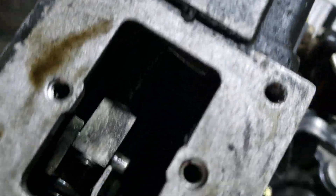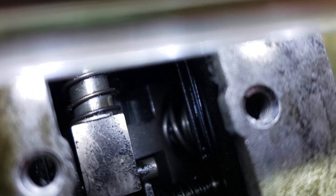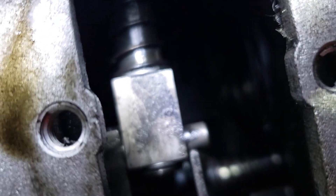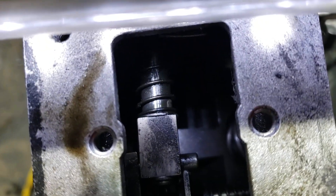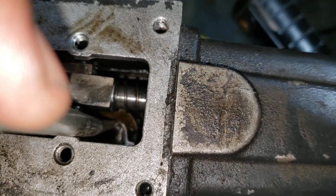As you can see, we've got not a huge opening but it's also not insignificant, and down in there you can see the springs. When you get this to the right spot you're going to be able to see the springs basically facing up right against this governor - that's where the governor comes up and it's got the governor foot that comes up there and rides against it, so it's going to be basically sticking straight up.